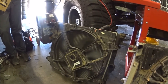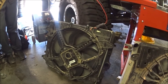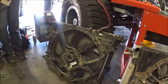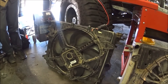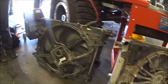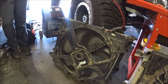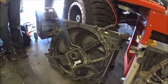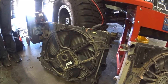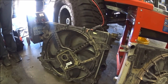It's rare you will run this fan at that speed for any amount of time, because we're finding that even in the high compression LS3s, these fans are only running 30%, 40%, 50% to keep the engines cool, even here in Vegas when it's close to 120 degrees out. Just wanted to show you a quick glimpse of these fan assemblies. We do support the PentaStar fan now in all the JKs running our swap if you're looking to upgrade. We also have some new radiators that we'll show in another video. Thanks.